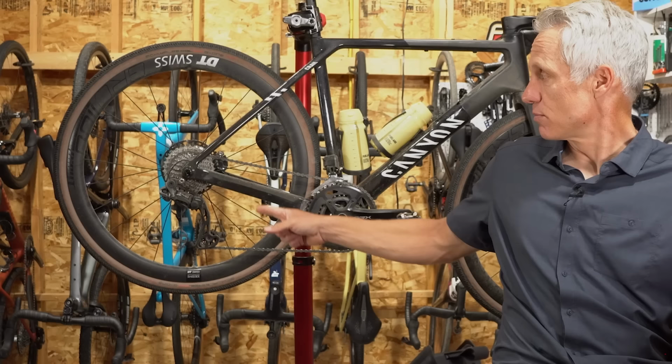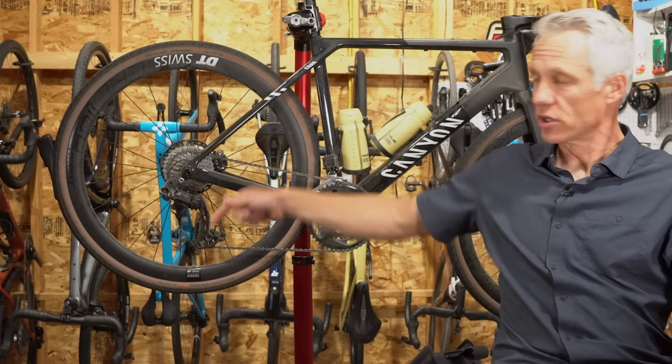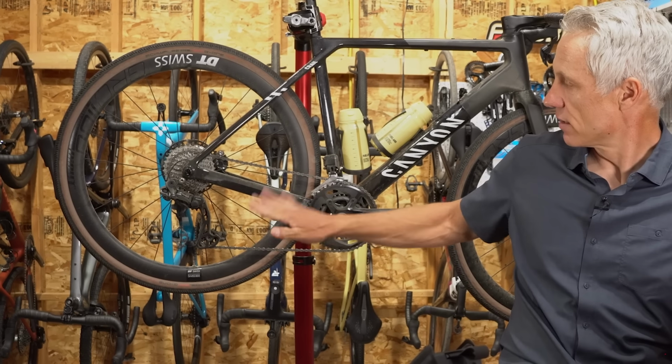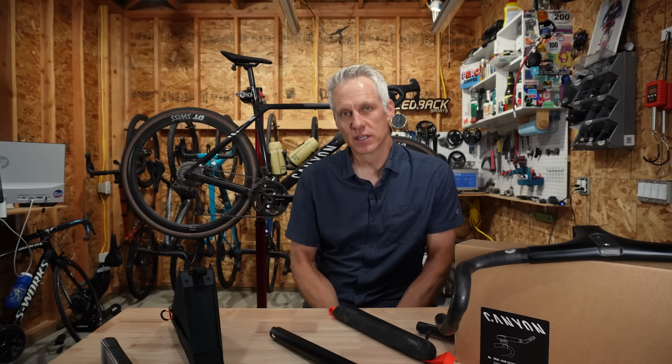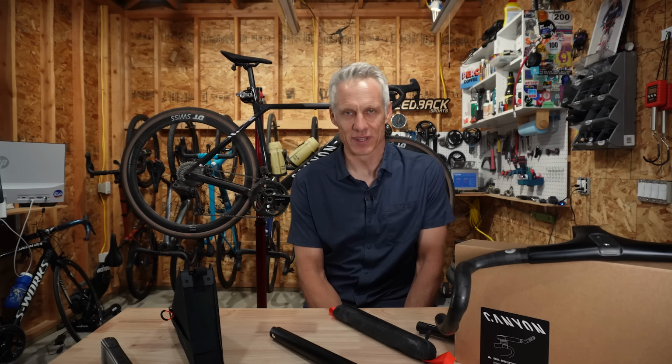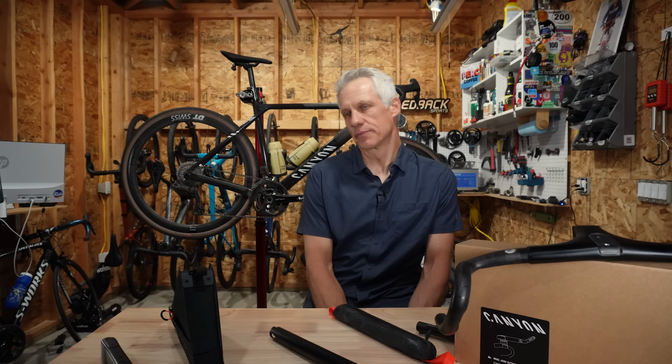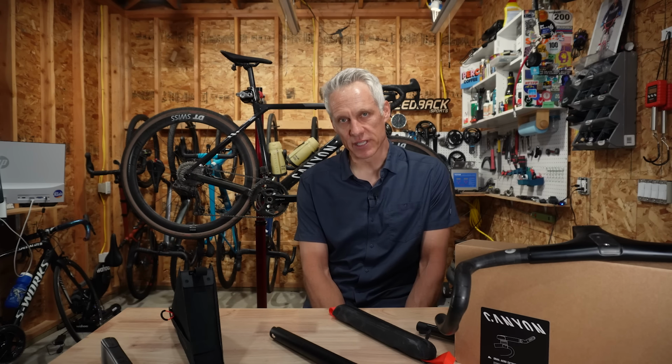Should also mention something I neglected to touch on earlier, the Universal Derailleur Hanger, new for this year. Not necessarily relevant for Shimano bikes, but for SRAM you can run a mullet, you can run the Eagle derailleur with no derailleur hanger, and that is a much tougher overall solution. So it's not future-proof, nothing's ever future-proof, bikes are always changing, but certainly forward-looking compatibility at the rear end.